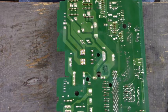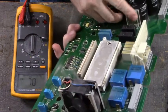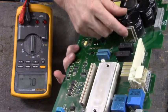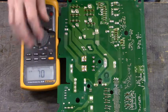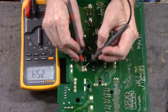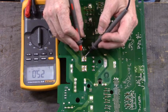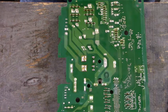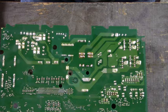There we go - now let's measure across the relays. Now we should see the pre-charge resistors. These two right here - these are the pre-charge resistors, look like little hybrid modules. There's 25 ohms of pre-charge resistance across those two contacts, and there's 25 ohms of pre-charge resistance across these two contacts. We're good to go - fixed another one! We'll throw that back together. I can't test this here - this drive is much more complicated than I can make it run.